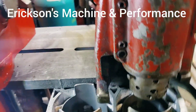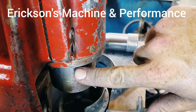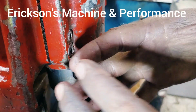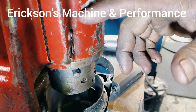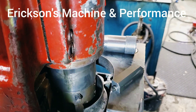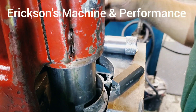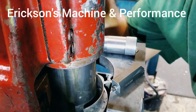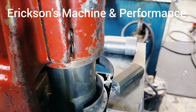Now that we have all that set up, we can go to the machine and center this on the bore. There are feet on the boring bar — this is what centers inside the cylinder. The three feet expand out and push to center it. You then lock down the boring bar, bring the bar back up, and start cutting. We drop this down in the hole, open up the feet using the knob on top. When the feet are open and the bar is centered, we lock down the locking bolt, back the feet off, and bring it back up.